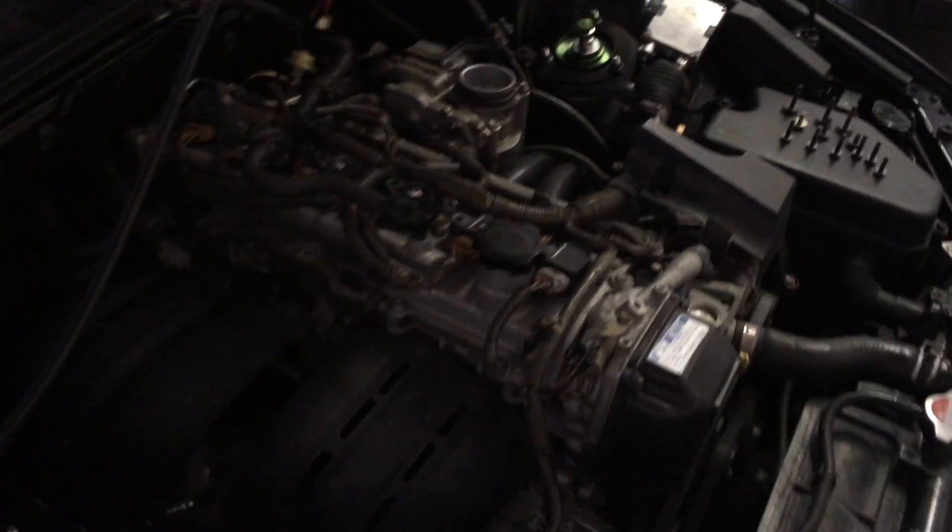You know there's unburned fuel going into the exhaust. Right now you can hear the catalytic converter pre-igniting. I'm not sure if you can see that too well down there, but there's a little orange dot — it's actually detonating the fuel in the catalyst because it's that hot. So I'm going to shut the engine off now, because I know which one we're looking for.